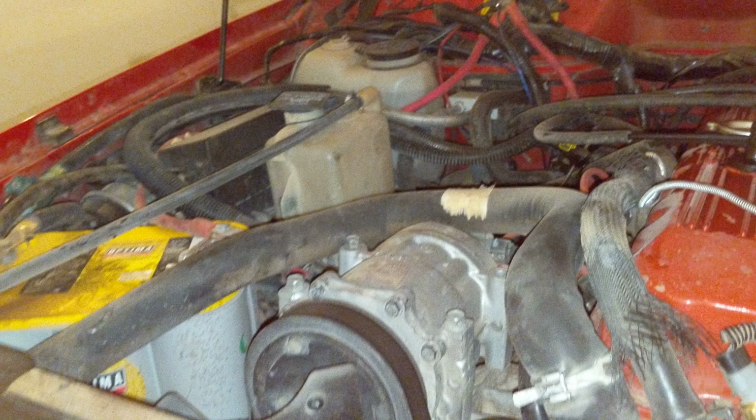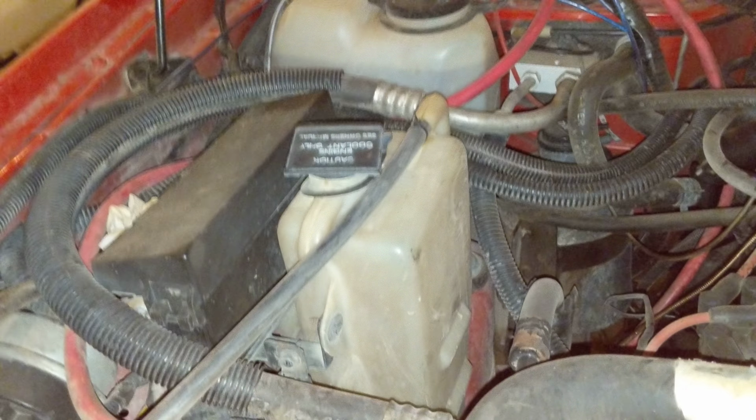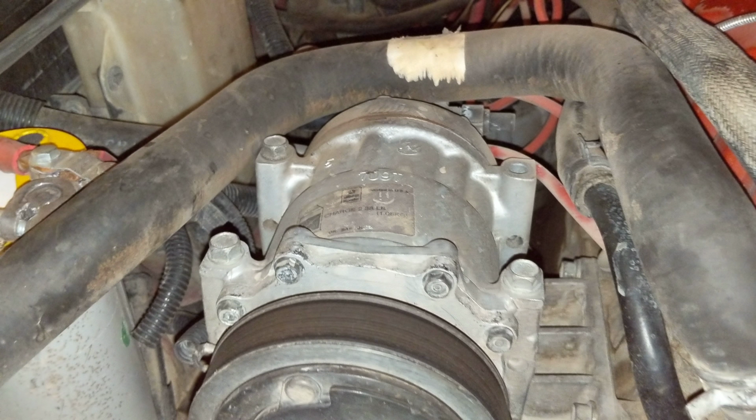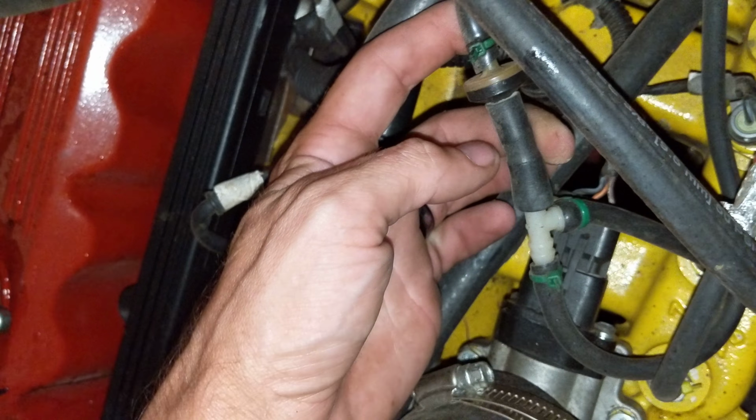The manifold. Most people put these turbos on that side of the Jeep, which I don't see why. There's a distributor, there's all of that electronic stuff, there's... You probably even have to remove your AC pump in most cases. Which, I like my AC. It's very nice to have, especially on a dirt road when you're following people. The only thing that you have to do to turbo these things is put the turbo on and put in a check valve right there that goes to the MAP sensor. So the MAP sensor doesn't see boost because it can't read boost.